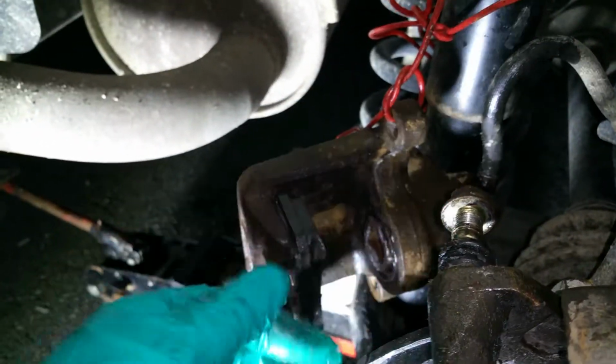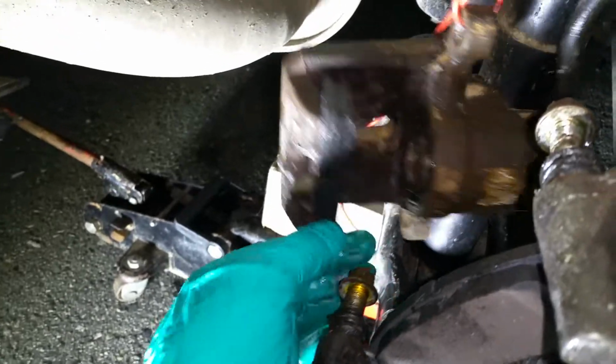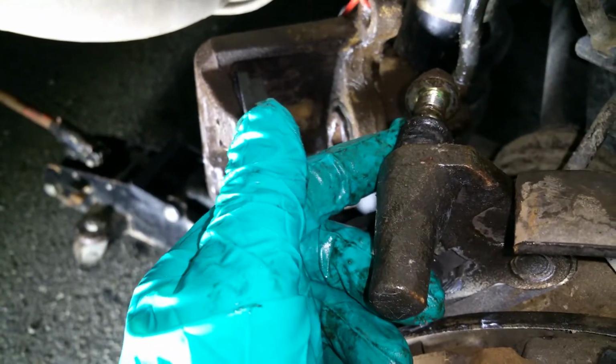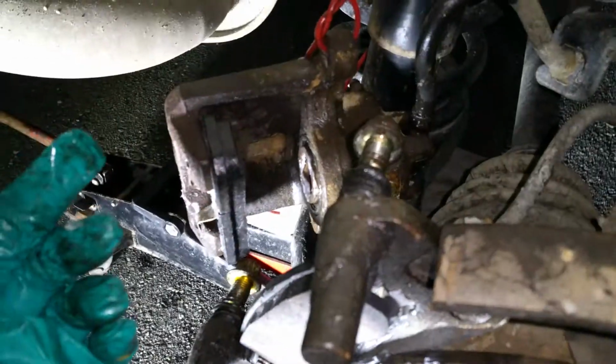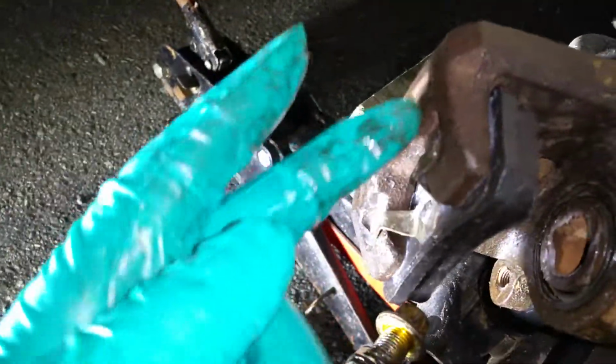You don't have to feel much of a resistance. You feel some sort of a soft silicone sliding action here, and that's supposed to go. And check the rubber. This is kind of a seal that prevents the water and the dirt from getting into the lubricated area, the sliding area. Okay, so I installed this brake pad here, so the opposite one, and it has some sort of a hose on the side, so make sure you seat this one properly, and you lubricate all the contact points, so contact between the caliper and the brake pad, behind.